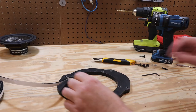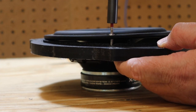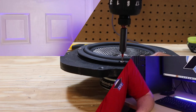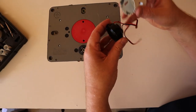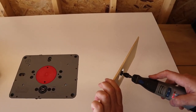Before I mount the speaker ring I'm going to add some gasket material, and I'll give you a link in the video description to that. Now, what about the tweeters? These tweeters did not come with any type of mounting hardware at all. So my plan is to make some very tight fitting adapters and hold them in place with just pressure and some double-sided tape — maybe I'll wrap some gasket material around the back side so it's harder for them to pop out. I'm going to grab my hole saw kit and check to see if I have one the same size as the outside diameter of the tweeter. And I don't — this one is close but not quite.